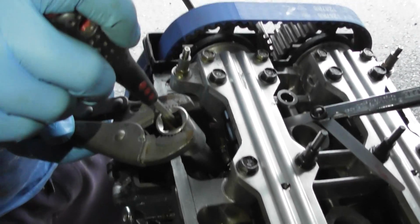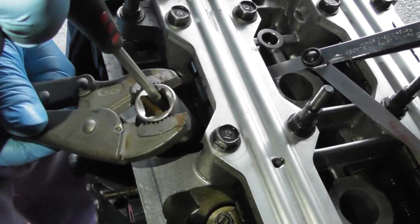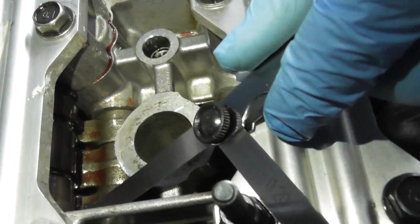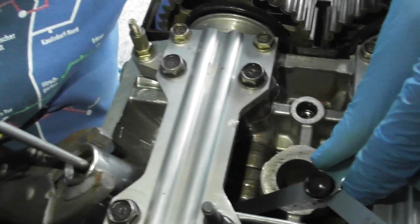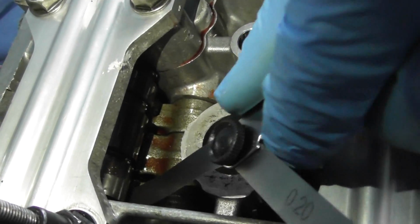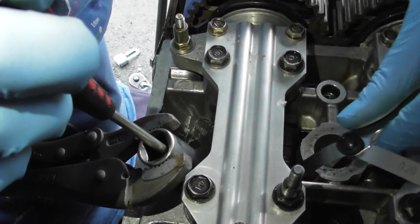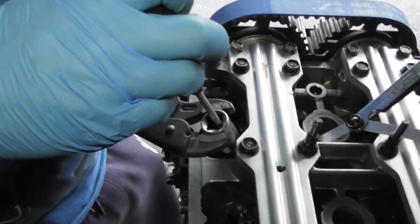That's tight. Then I go over to exactly the same process on the next one. So screwdriver down, my socket over the lock nut, move this over to the next point, which is just down here. Then I need to just loosen it a little bit. So there, it's easy to drag it in and out now. Then I just tighten up the screwdriver, and as I go I'm still moving the feeler gauge to the point where I have a light drag. I'm happy with that there. Keep the screwdriver steady, tighten that up.